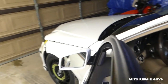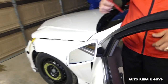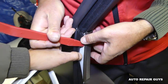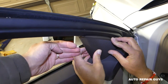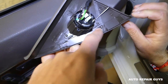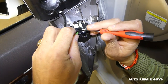Next we need to remove the cover right here. With the window down it's really helpful. Come here, remove the seal a little bit out of the way with the plastic removal tool, then pry the cap open. Come in at an angle towards the front — there are three clips. Let me show you where they're located: one, two, three — they go into these holes right here.